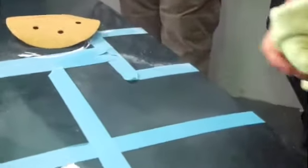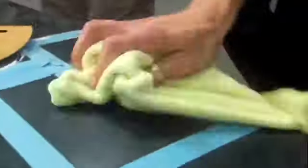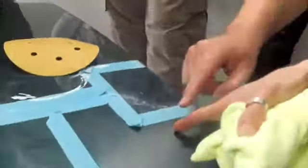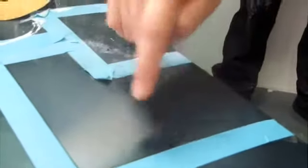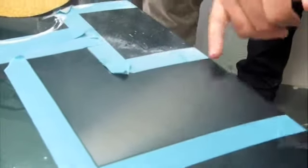We've got plenty. I mean, what we'll do is we'll flip out the machines, the hand pads, and scratch your own panels back up again. We're just trying to get an idea. So still there, from what I did. Your work area is that wide, and I've done mine slightly wider, so you can actually see then the bit that you've got on top. But yeah, you can still see some scratches going that way. So we've done 2 sets there at say a 4000 pad. It might be worth now saying, okay, well we're not going to get it out with the 4000 without doing multiple hits.